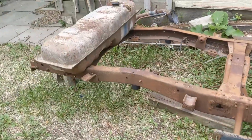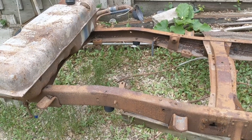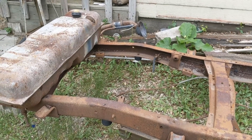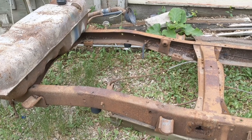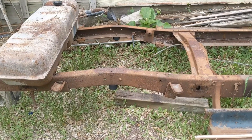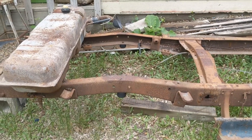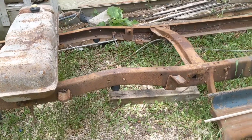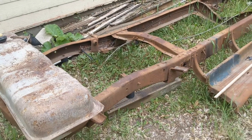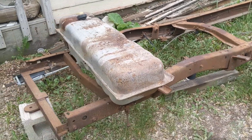Let me know if you'd like to see that cab on this frame. For the rear end, I've got a '57-to-'72 9-inch from an F100 which I hear works, and also a 4-wheel drive S10 or S10 Blazer 10-bolt works — they're close to the right dimensions. There are also a few '60s GM car rear ends that work, like Impalas or Biscaynes — those are 10-bolt as well. The Ford Explorer 8.8 works pretty well, and I've also heard of an '80s-'90s Thunderbird independent rear end.